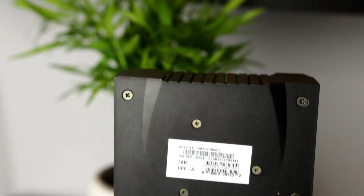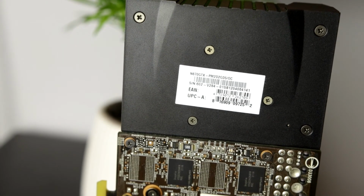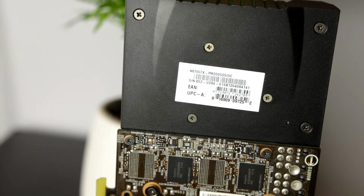And you probably need some popcorn because it hasn't aged that well, but I'm gonna get ahead of myself. Let's get into some benchmarks. The specs are as follows. The Intel Core i7-4770K at 4.4 GHz with 16 GB of DDR3 memory running at 1866 MHz. The latest drivers from Nvidia are used, and we are using the Windows 20H2 update.